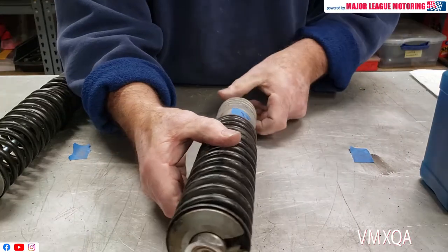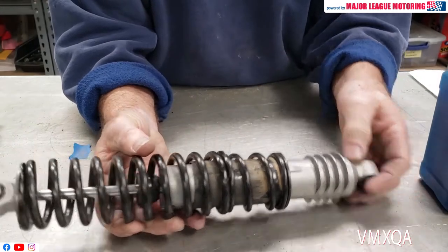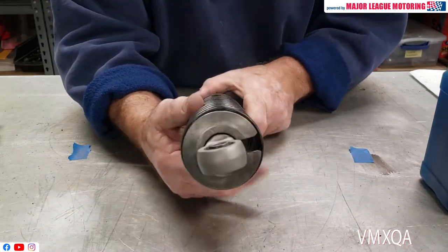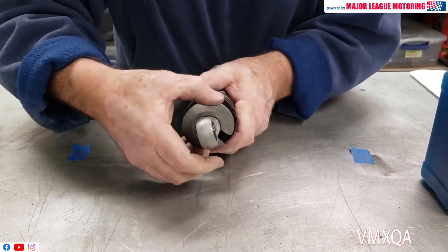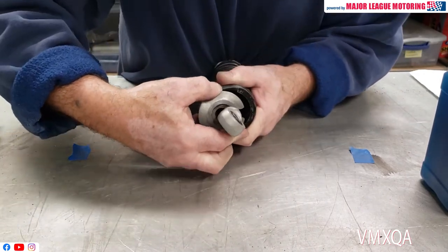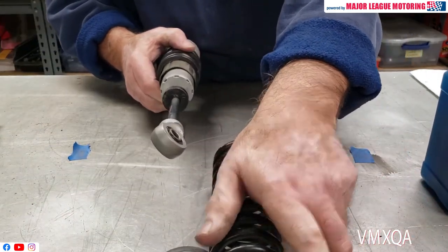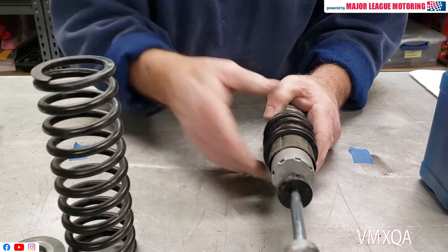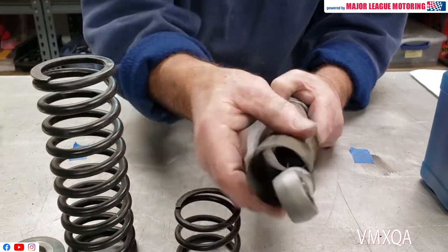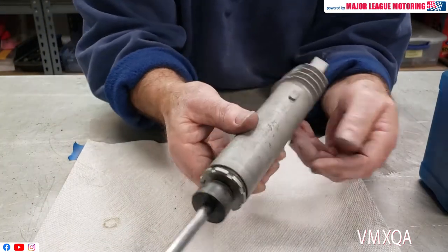Here's the shock — you can see it complete. It's the same on Elsinore 125s and 250s. What I had done for this picture was I took off the adjuster on the bottom so I could show you how to take off the spring retainer at the top. It's not that easy with the adjuster on the bottom. You may need a spring retainer tool to get it off, or have a friend help you as you push down on that to get the spring off the shock. Once you get it off, the pictures speak for themselves.